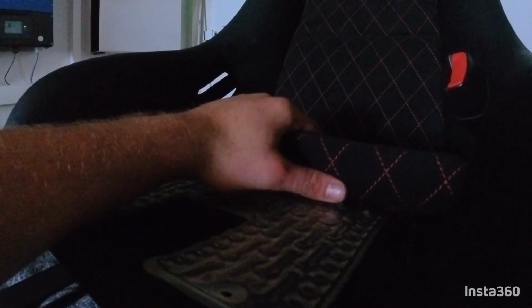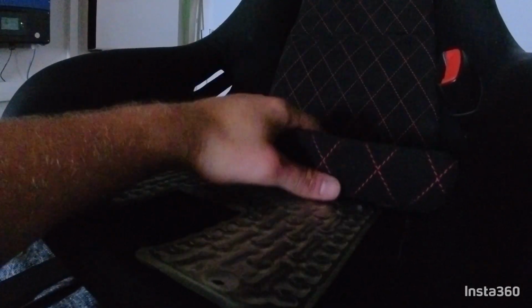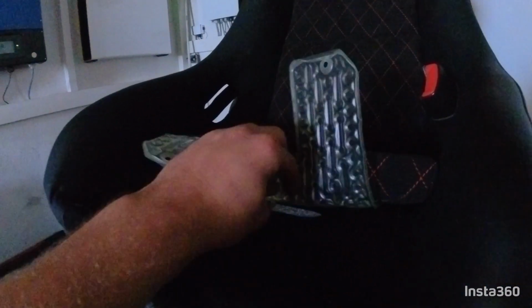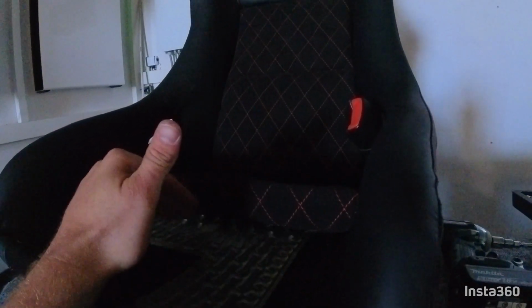The nice thing about those Recaro seats here is that the cushions are just put on with Velcro, so you can take them off, put this mat underneath the Velcro, and basically have it function like original, which is pretty cool. And since you have a hole in the middle of the seat right there, because it's a 3-point harness, you can just take the original cable, which is this one here, and run it under the seat, plug it in to the original harness, and good to go. And it even functions, which is pretty nice, I think.